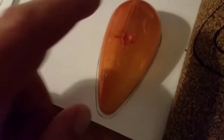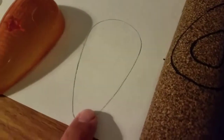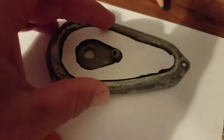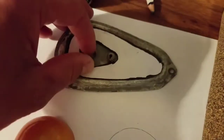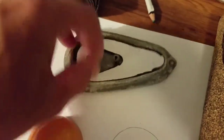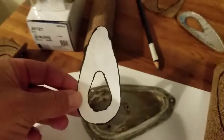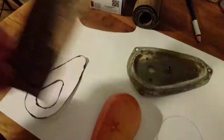What I did is I took my lens and traced it out onto a piece of paper, cut that shape out, then set it in the housing and marked the holes — the mounting hole and where the light bulb goes. It kind of got this avocado shape but it worked pretty good, so I transferred that to the cork gasket material and got it cut out.